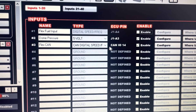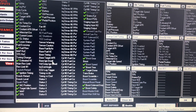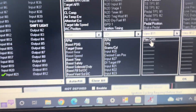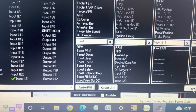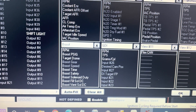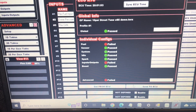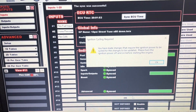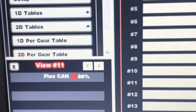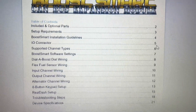Let's connect to the car. Before starting the car, I'm going to go into my signal list, look for flex CAN, and drag it over to a view — we have it as U11. By doing this, when I start the car I'll be able to monitor that parameter. I also have a Holley 7-inch dash that should be able to pull that value. The car is running, and on the bottom left you can see the input we just set as a view — we're reading about 85, which is what the test tube tested. Everything's working great.